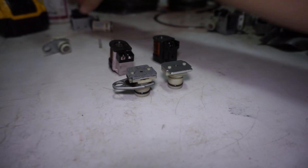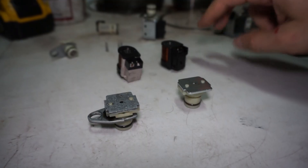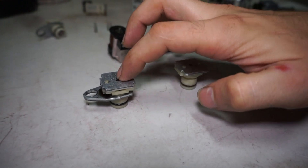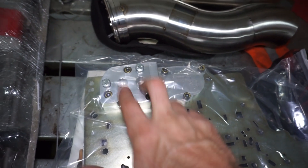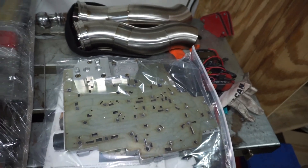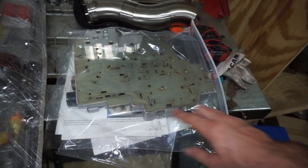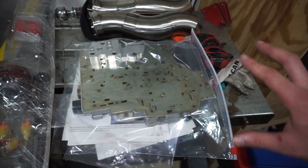What I ended up doing to get it to kind of work was I swapped out the shift solenoids used for the trans brake. The trans brake came with a different style solenoid - a Transtar I think - and it was not a factory AC Delco solenoid. So I put a set of AC Delco solenoids in for the trans brake section in this aluminum block, and then it actually started releasing. I didn't have problems with it binding or releasing anymore after that, and I was doing test hits - that's when the converter failed. It did send a bunch of metal through this thing, so I spent about five hours cleaning it, pulling all the valves and springs, making sure everything is completely clean.